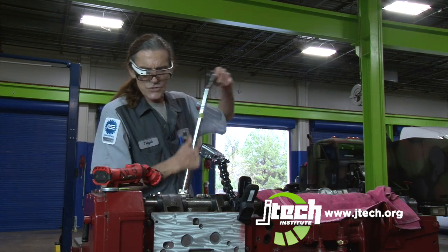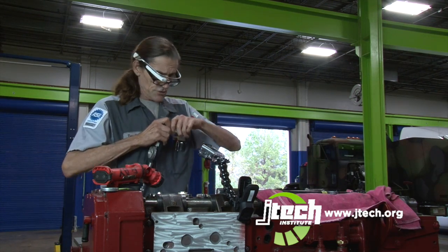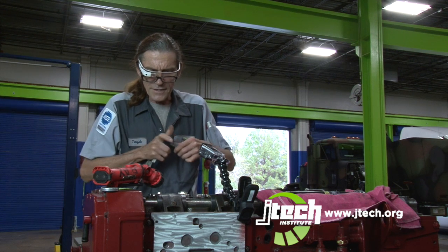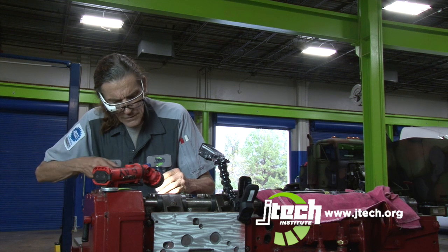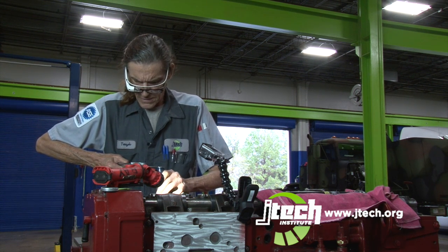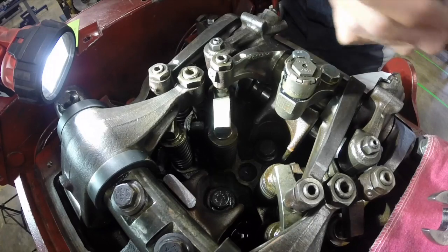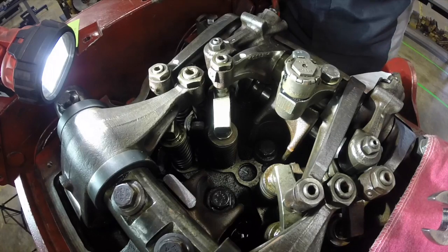Okay, and now this one's torqued at 177 inch-pounds. So I have an inch-pound torque wrench dial, because it's only like a 5/16 coarse thread, so it won't take much torque. So 176, 175, 76 inch-pounds. Okay, and then I mark it. So that has my Jake brake done.